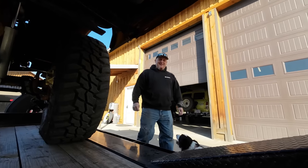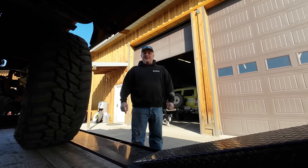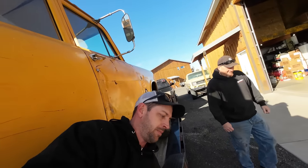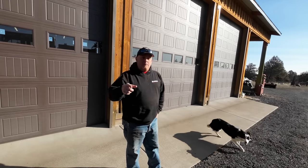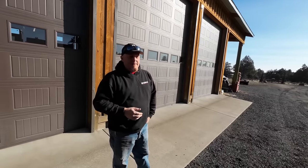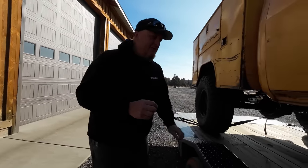Good morning - I was just explaining the mad dash overnight transmission rebuild. Yeah, and the one-day in-and-out exhaust - it usually takes three days. That is a work of art. Gavin at Elite Fleet Automotive stayed at work all night long and rebuilt the same transmission from four-wheel drive to two-wheel drive. It's the same transmission but we changed the tail housing from four-wheel drive to two-wheel drive, so it doesn't have to have a mated transfer case. Now it's divorced, so we can put the intermediate shaft in the way the truck was originally.